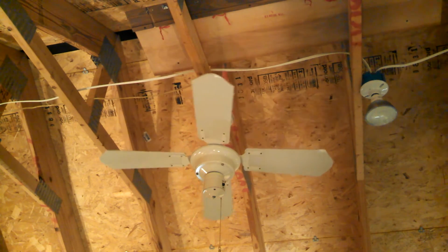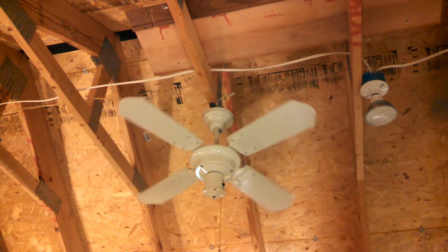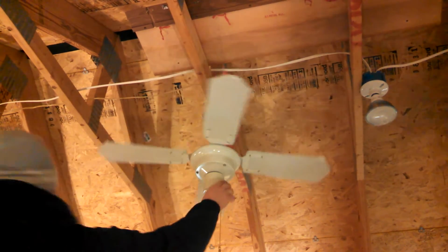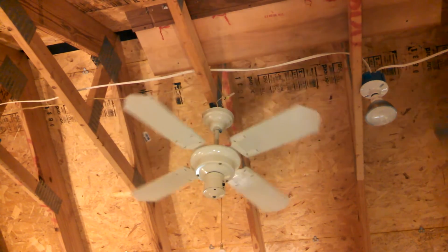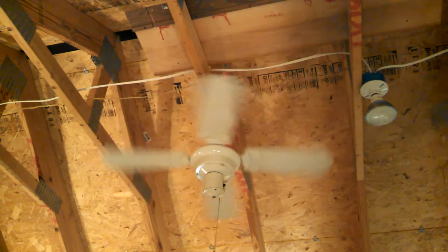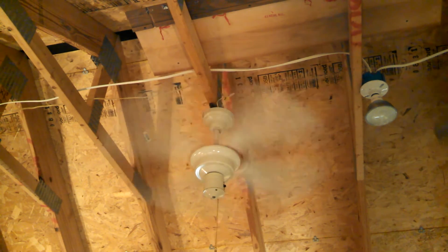So I think the only thing better to get than a 4, we could always try a 3.75 or a 3.5 microfarad and see if it starts on low. But you're not going to get too much better than that 4. Just out of curiosity, now it draws 0.07. Okay, back to forward. Now if I go an eighth of a turn, 0.39. No buzz so far. Another eighth of a turn, 0.56. Another eighth of a turn is actually all the way to high. And it was silent with the variable speed. So that's pretty cool.